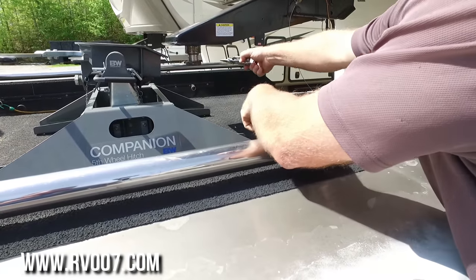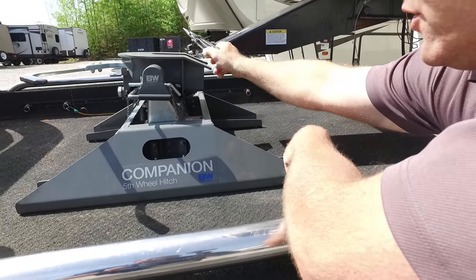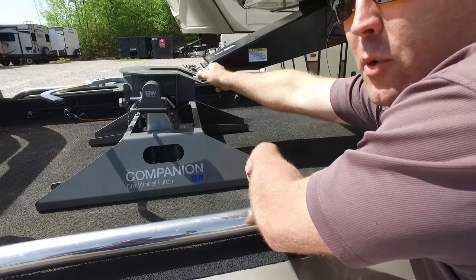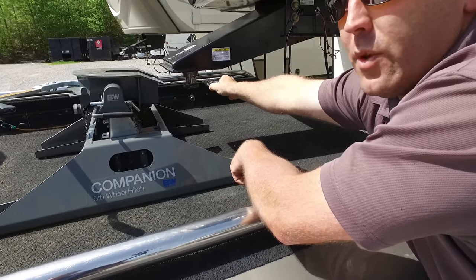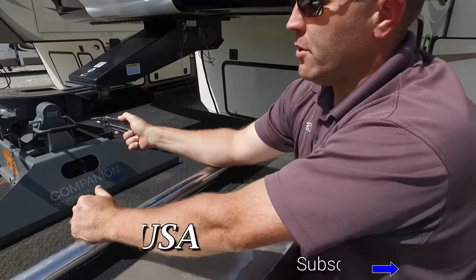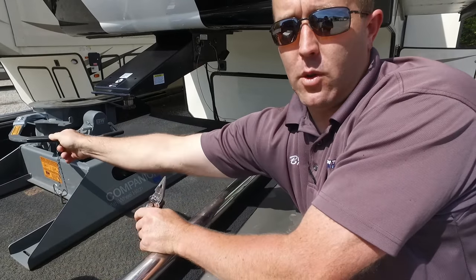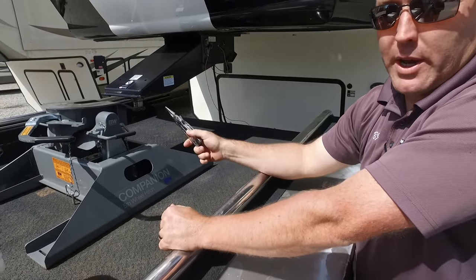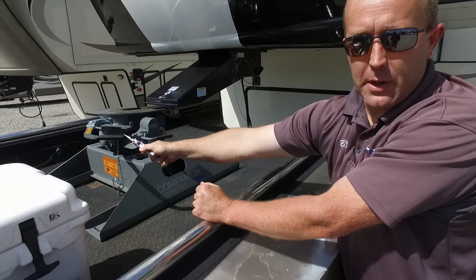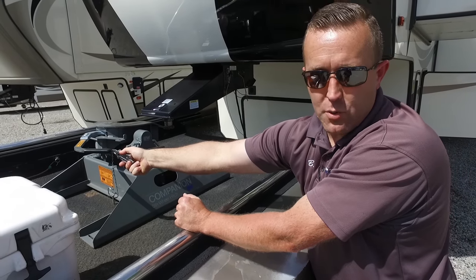At the correct height, when I back this truck up, the downward plate is going to hit right here, the truck will squat and slide under, and I'll have contact the entire time on the face of the hitch. That'll make sure the pin lines up in the correct position. There are a lot of different fifth wheels — the one we're using today is a B&W Companion. With this particular hitch, we have to have the handle open. There are multiple hitches that all hook up the same way but have different handle designs, so be sure your handle or latching mechanism is open when you back in.